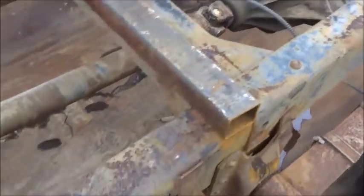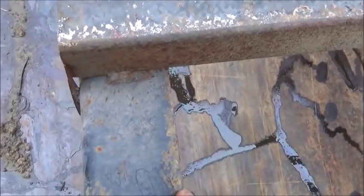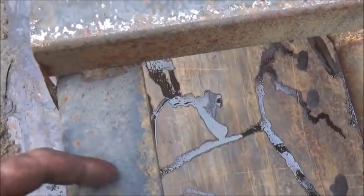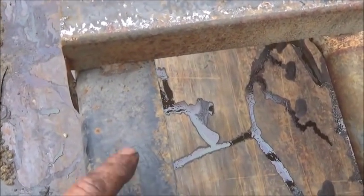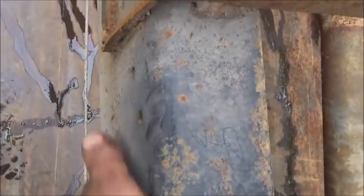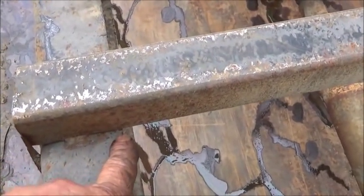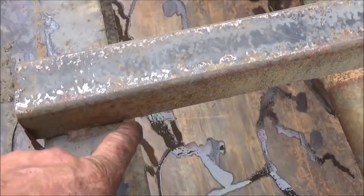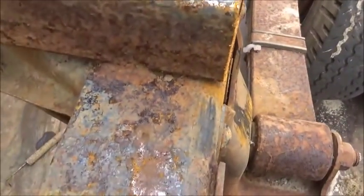Okay, here's the difference. You see they welded on top of the frame rail, on the flange, that's what they call it, and not just what I call it, but what the actual factory calls it. And it's okay to weld anywhere over here. You don't want to weld up here. Now you can see this weld doesn't go to the end, and that's probably the reason that it didn't cause any issues. And all of them seem to be that way until you get to this one,